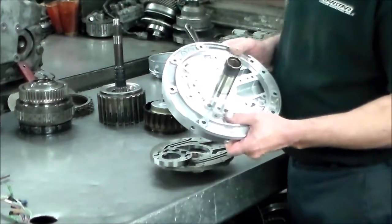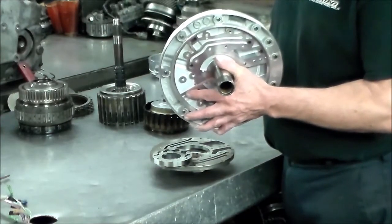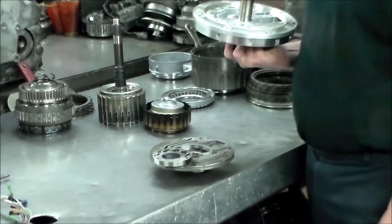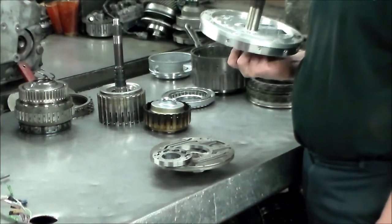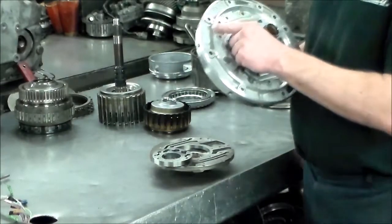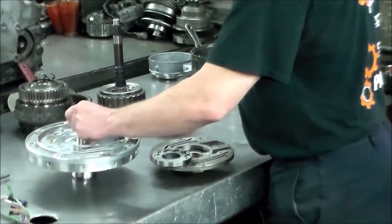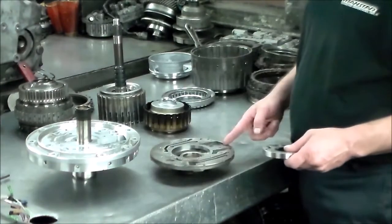And the stator. There's really only one pump, of course, for this A960, as there is with the other ones. And I needed a pump for that A960, and the first one I had ordered came incorrect. Then I started doing some research online, and they started talking about a casting number, which says T1 over here. I was researching a T1, a T2, but the A960 pump is rather large, so there's really only one. This is 8 inches across here.